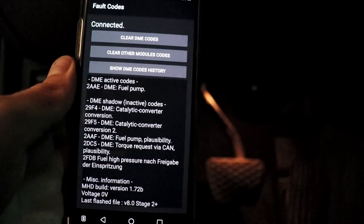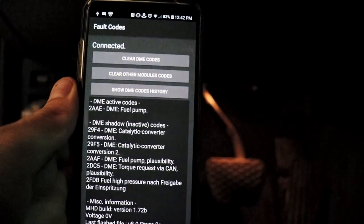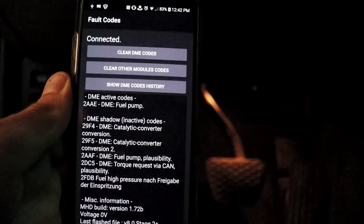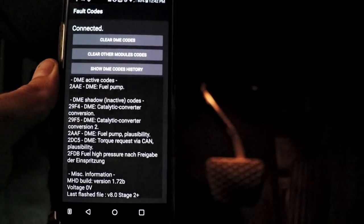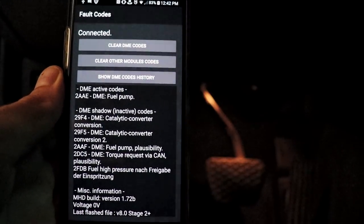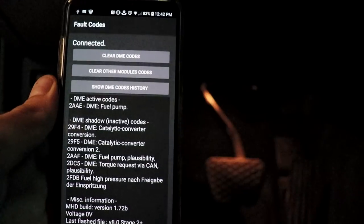I have this code because I installed the Walbro 455 E85 compatible fuel pump. It's a stage 2 plus fuel pump, so I can run more than 50% ethanol. So that's expected. You will get this if you have a third generation fuel pump module on your E90. I've actually upgraded from a second generation to a third generation. There's an old video on my channel showing you guys that.